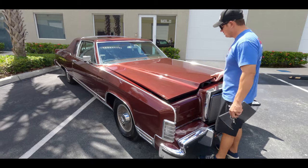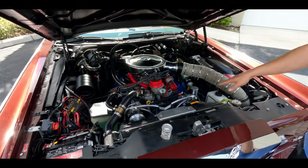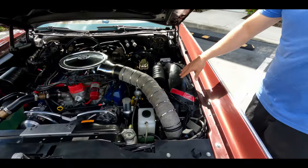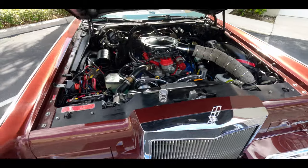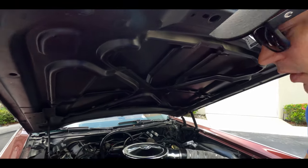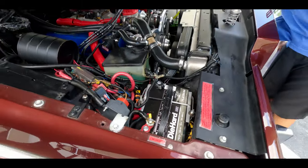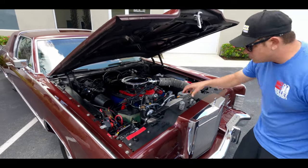As I open up the hood, look at how beautiful the metallic is on here. You have a 460 — a rebuilt motor from Jasper. It has the March serpentine setup in the front, MSD ignition, and an additional kill switch. The AC is ice cold. You do have a fire suppression system as well. There are notes throughout explaining how switches work, including an emergency fan switch. Our client removed the hood insulation to allow the engine to let heat out more. There's an auxiliary pump for the coolant that cycles coolant when you turn it off, keeping the engine cooler. The Griffin radiator is almost three inches — huge — to keep it cool. All fuses and relays are labeled. The engine bay is just spectacular.